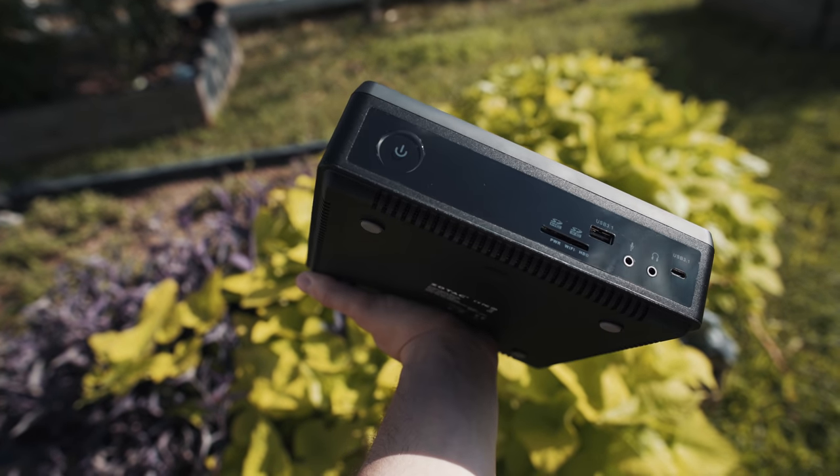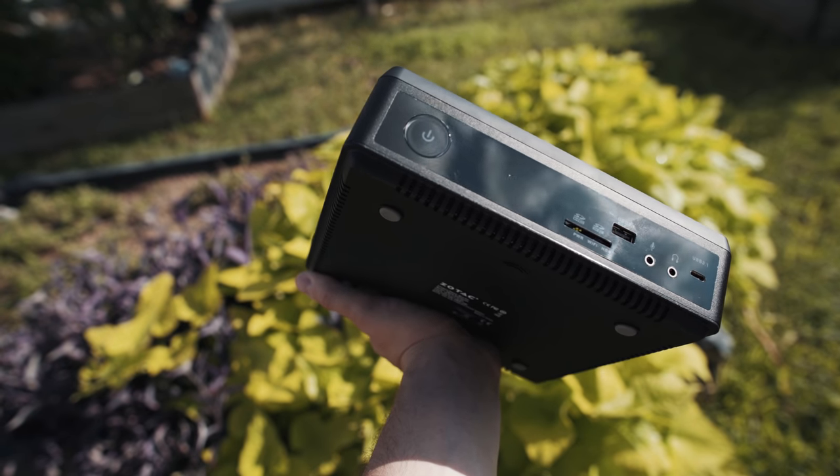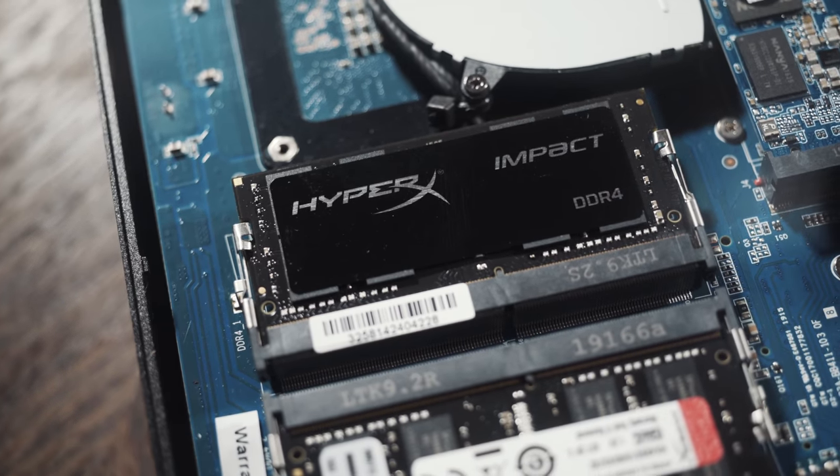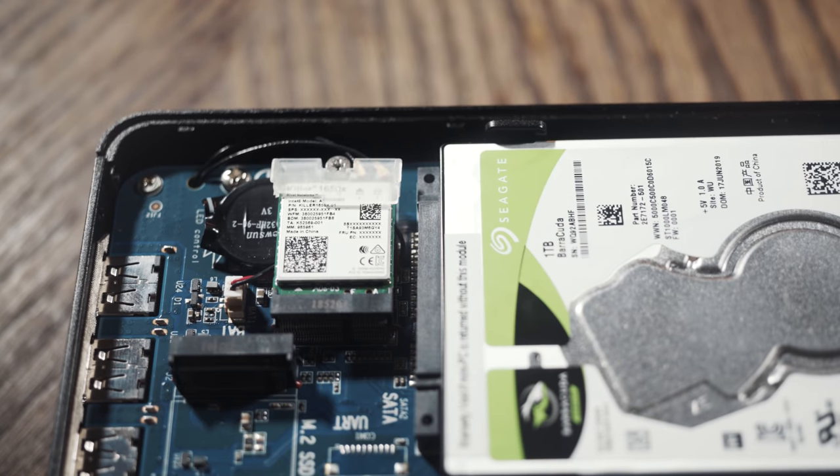So my recommendation is that if you opt to purchase the Zotac Magnus, I would recommend maxing out your RAM with 32 gigabytes and also using Throttle Stop to undervolt your CPU a little bit so it runs cooler. Many of you have asked: video rendering is great, but rendering is such a small part of the video editing process. How does this computer handle scrubbing on a timeline? Does it play back 4K video smoothly while editing? The CPU and GPU are important to playback speed, but the amount of RAM your computer has, as well as the hard drive speed your video clips are stored on, is arguably just as important. I edit my videos off of an external SSD so the video files load very fast, and I recommend you do the same.